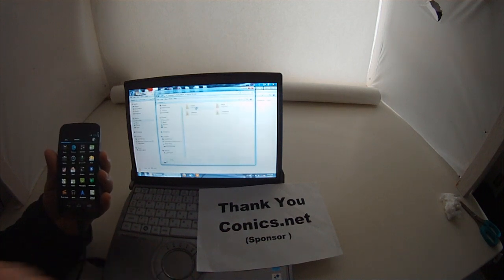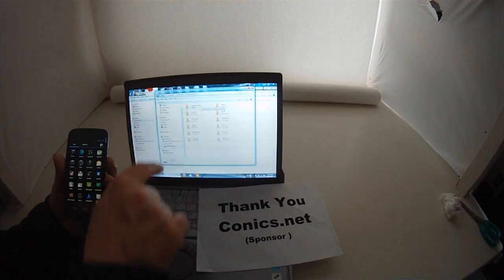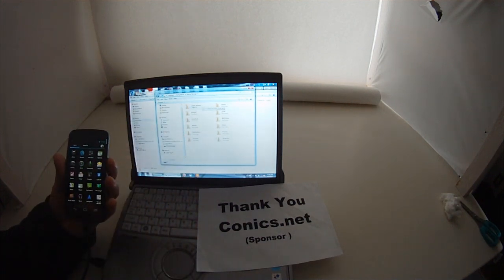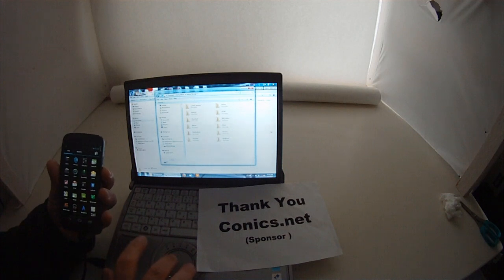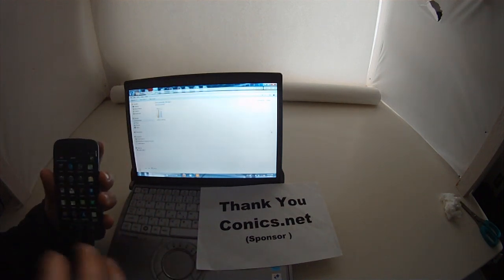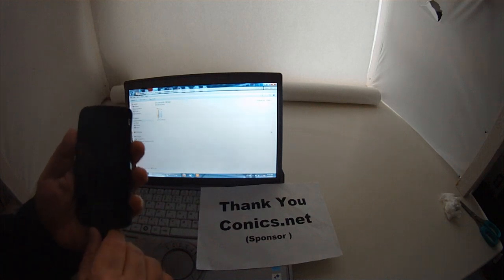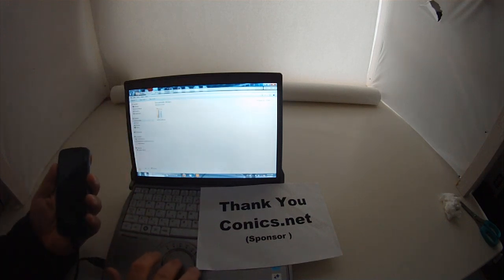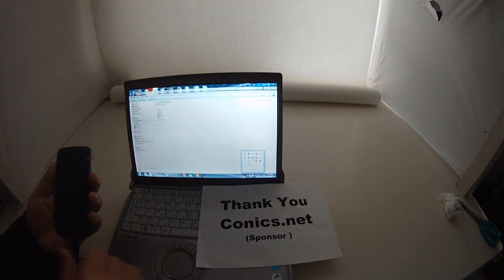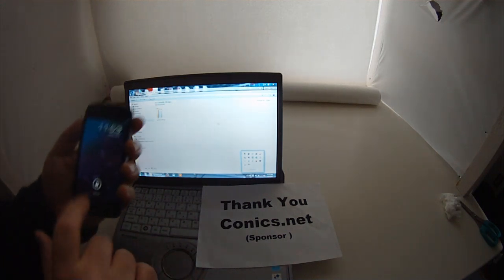It's the internal SD card storage. One of the folders is called unlock_backup. You're going to copy that folder and save it onto your computer somewhere, which I've already done. Because if you flash the phone, that folder gets erased, so it's very important to keep it before you start anything. Once you do that, you can tell your computer to shut off USB and unplug.